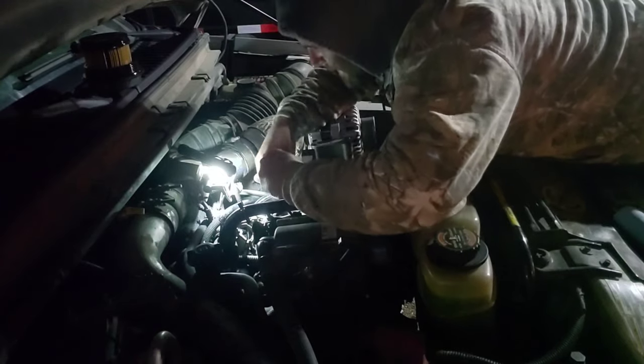We're going to go ahead and put another new 30-amp fuse in — right there, that's the new 30-amp. Grab the truck keys. We're going to look for the wait-to-start light to come on on the dash for the glow plugs. And there it is — wait to start, she's on. This truck will run now, guaranteed. Let the fuel filter fill back up because we drained all the fuel, we'll cycle this again. Now we'll try it. Look at that — that's beautiful. Finally, that's what we wanted to see.